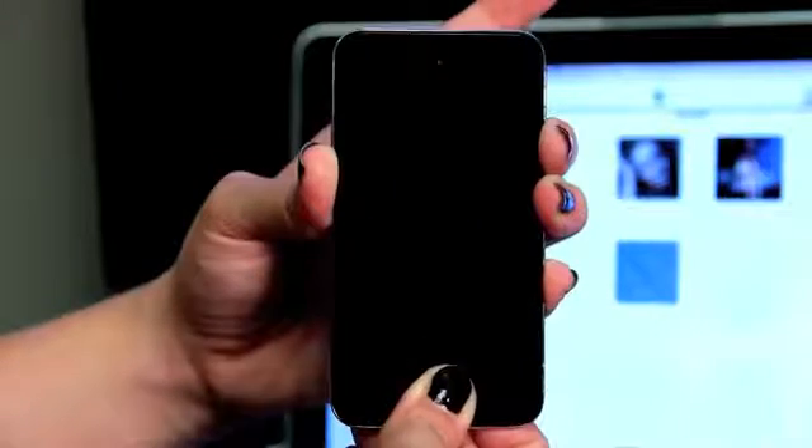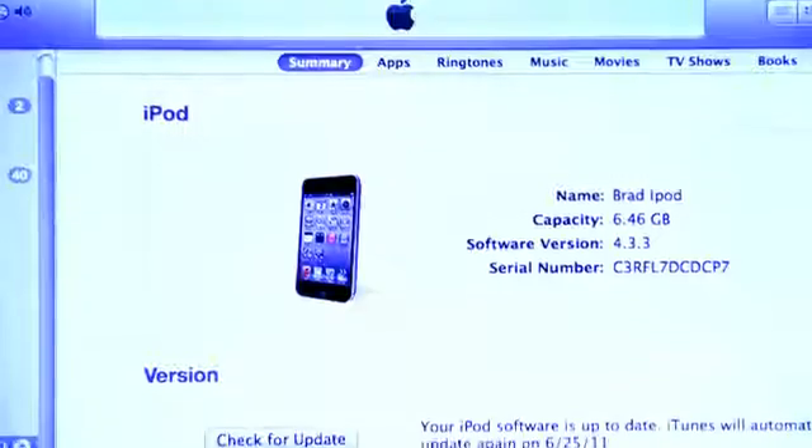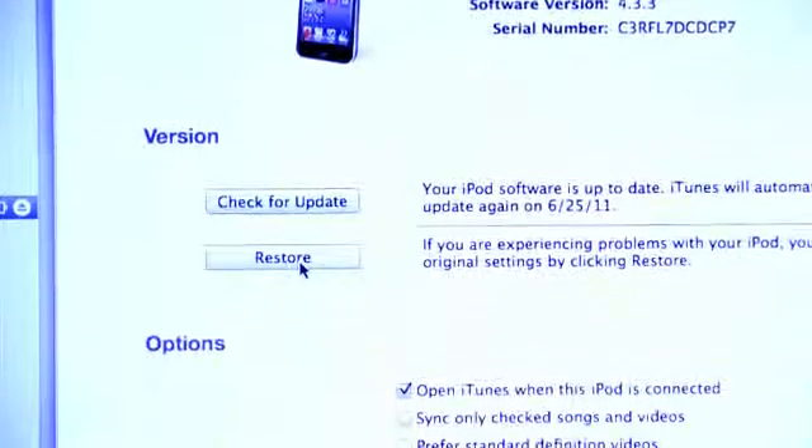Because there's nothing wrong with this iPod, it's just going to restart. If there had been something wrong with the iPod, the iTunes symbol with a 30-pin connector — that's what you would have seen. However, in DFU mode, it would then tell you to plug it into iTunes. The next step from that would be to restore. You would still lose everything, but it's a way to get iTunes to recognize the device. So that's what DFU mode is.